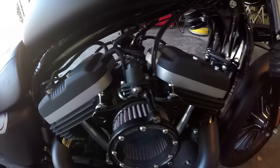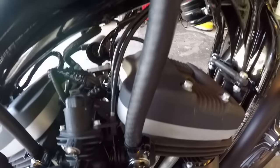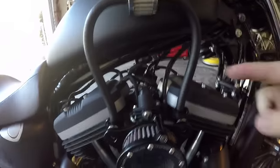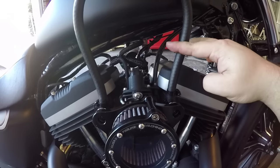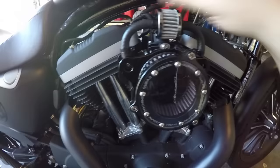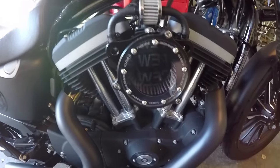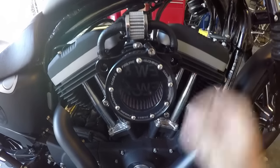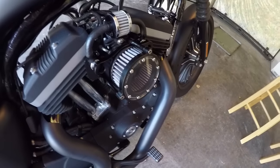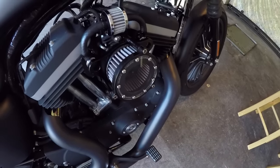Go ahead and add the hoses and clamps to the external breather system. Ran the hoses, put the clamps on — running it all the way up to the filter would be ridiculous, so you definitely have to trim the hoses. Set it to about right here and trim those off. Got the tubes trimmed up, things angled correctly, no real kinks. At this point, if you're just installing a filter without an external breather system, go ahead and snug everything down. If you have torque specs, use them. Make sure you use loctite because this is right on the side of the engine and it's going to shake — use loctite on all the bolts. There are three in there, use loctite on those.